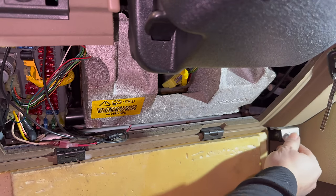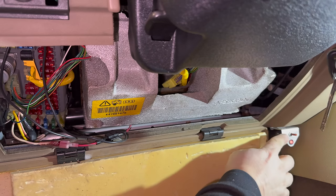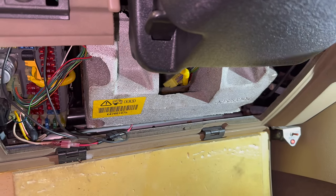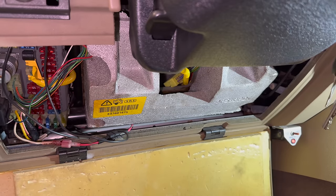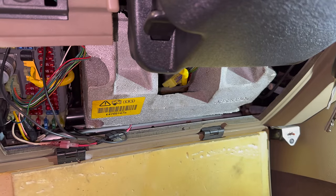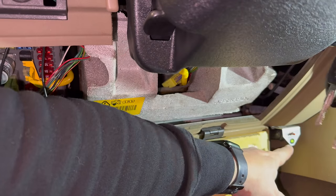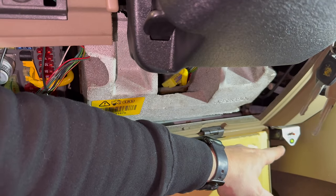Middle is off, to the right is emergency on. Emergency on is on and the ignition is on right now. When we turn the ignition off, emergency on is still on. If we switch to dual on — it's off. When we turn the ignition on, it's on. So that means in this mode the two batteries are not connected until the ignition is turned on.